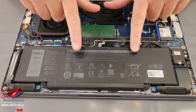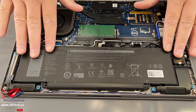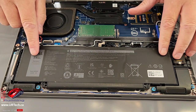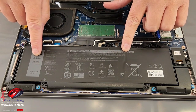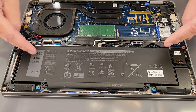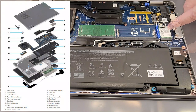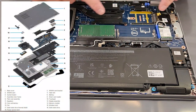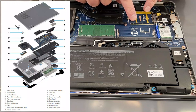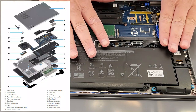Okay, what's in here? We have a three-cell 54-watt-hour battery. You used to be able to judge battery capacity just by the number of cells, but now you have to look at the watt-hour number — the cell count doesn't tell you enough. They sell this exact unit with a smaller 44-watt-hour battery. The speakers are here. That believe it or not is your solid-state hard drive — that's your SSD. This is your Wi-Fi card, and these cables are your antennas. That slot is for your WAN — better known as a cell connection — so if you put a cell card in here, you can use the SIM card slot we showed you earlier so the laptop is always connected.